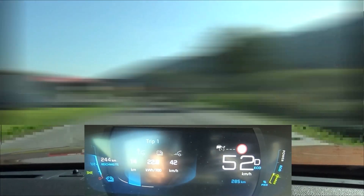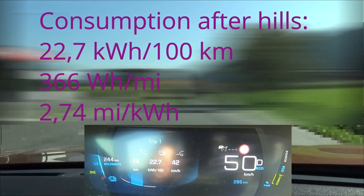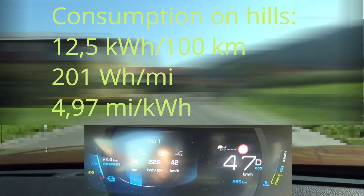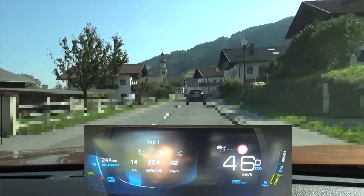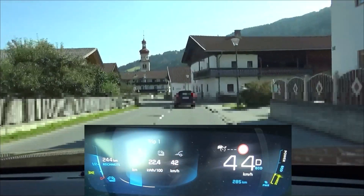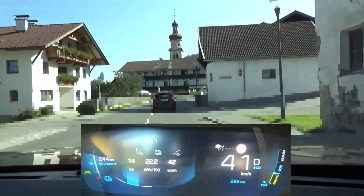22.7 kWh per 100 km at the end of the hills. Now we are descending to our starting altitude. With this very car and all EVs, and also hybrids with moderate power output — in this case 100 kW peak power — you have to keep in mind that you have at best 85–90 kW for electric braking, and this isn't really much, especially from higher speeds.